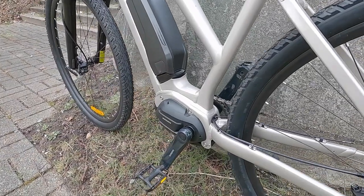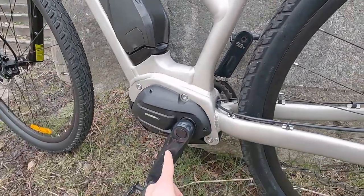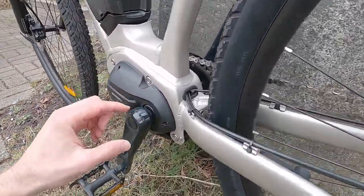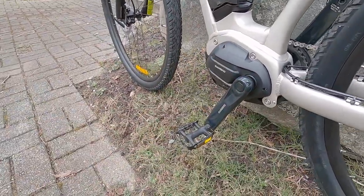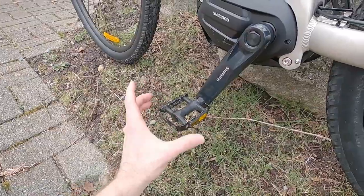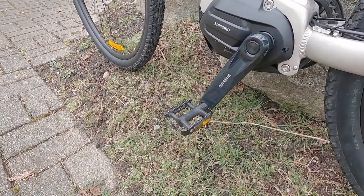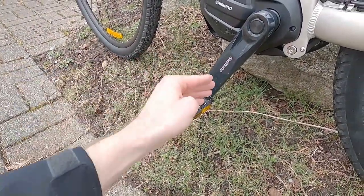It was interesting to see 175 millimeter length crank arms — these are Shimano-specific. They interface with the Shimano Steps E5000 motor, square tapered spindle, which is just kind of normal. The pedals are not my favorite, actually. You see how they're not super wide — you're not gonna get quite as much traction. If it's a snowy day, the snow's just gonna push right through because of this sharp metal surround.